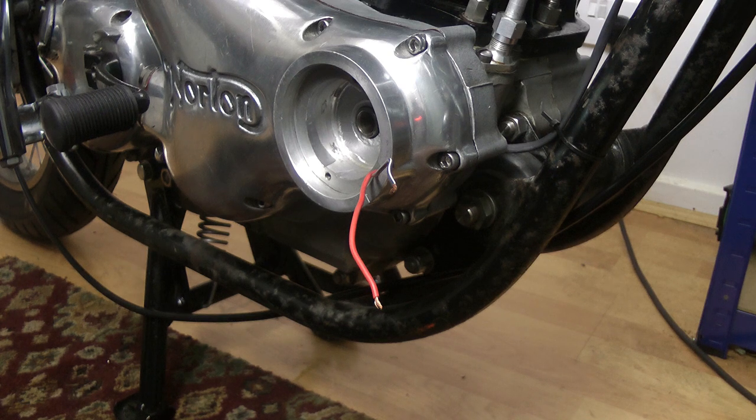And as long as the spark plugs are fitted, that's not an issue, because the energy can then dissipate. If, however, there's no spark plugs, the energy has to go somewhere, and it's going to actually try to find the lowest resistance way out, and that's often through the windings of the coil, or the insulation of the coil, to a ground point or to some return point. So there is some caution to be taken there, and while wiring everything up until you're happy that all the insulation is correct, I would suggest removing the power from the battery or whatever.